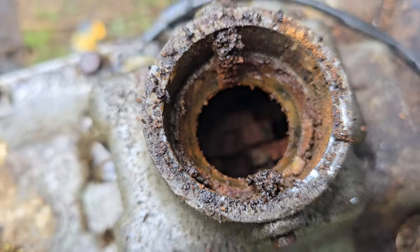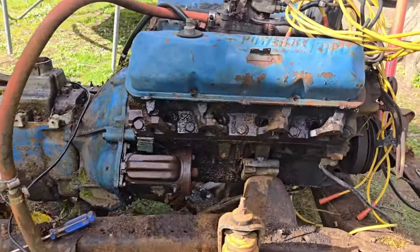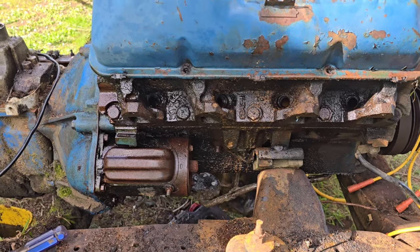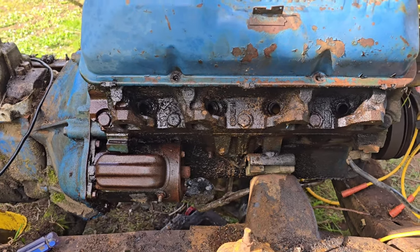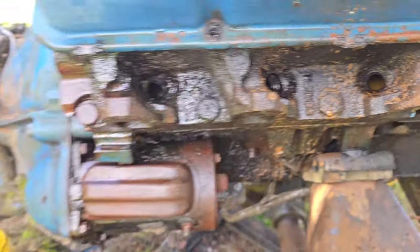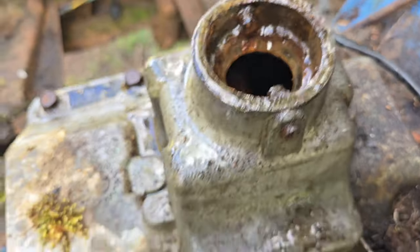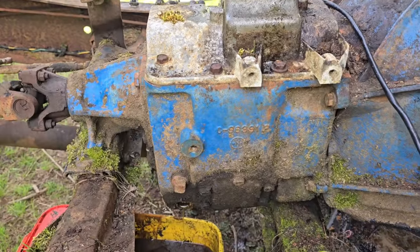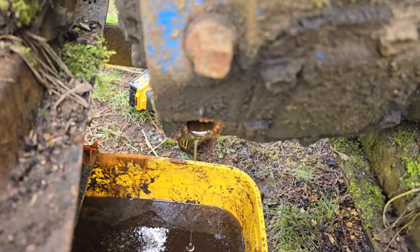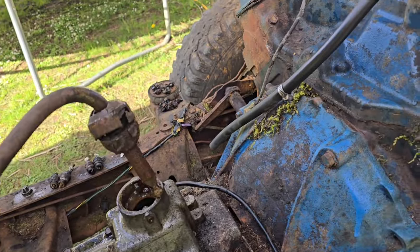Pretty bad. I'm going to dump some oil in it. All right, so I dumped some oil in it. I made a little concoction for the cylinders, some CLR, penetrating oil, stuff like that. So I got those soaking. And I dumped some oil down here. Let this soak. Thing had absolutely no oil in it. Probably all washed out with the water. Anyways, it's coming out clean now. But it looks pretty bad in there. I'm going to set this shifter back in there.